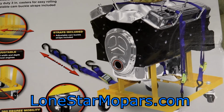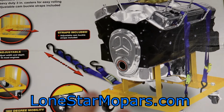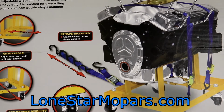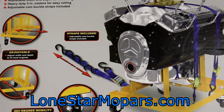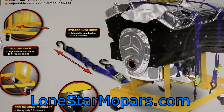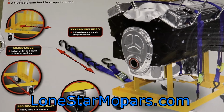That is your adjustability. So I don't know that the square tubing moves front to back. We'll have to figure all this out, but I do know that those legs will spread apart, as most legs do, right? And that's going to allow us, A, to fit massive oil pans, and B, to adjust from, say, a small block to a big block, to a slant 6 to a Hemi, to late model 5.7 or 6.4, all the way back to a 440, 426, 383 type of a thing, right?